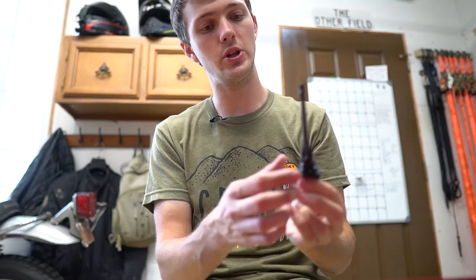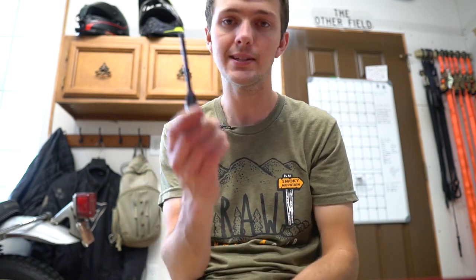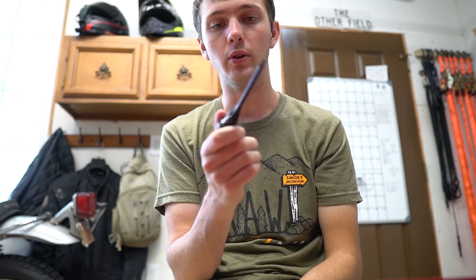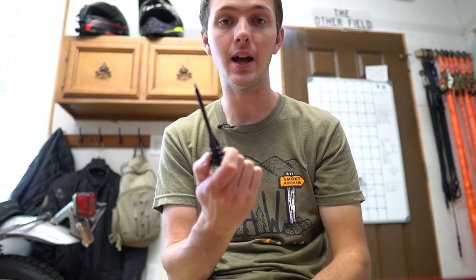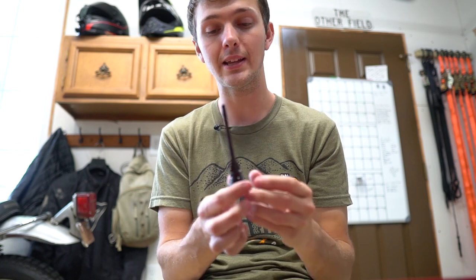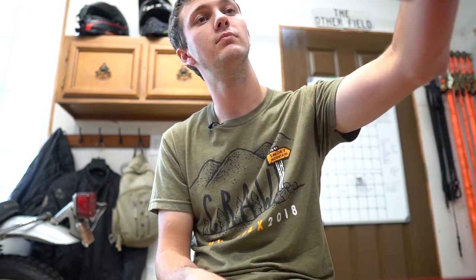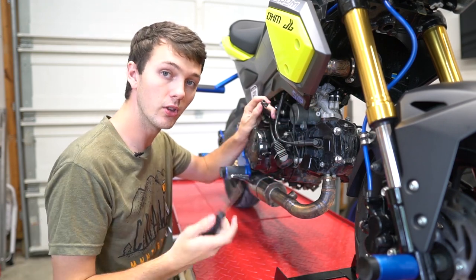So the first issue and the main issue that caused it to happen in the first place is I overfilled it with oil. This isn't the greatest representation, but it was a little past the line. So I took out a little bit of oil to try to help that. But that was the biggest issue. That's the biggest reason it happened. Obviously, oil still got in the motor, so I'm trying to help that from happening again. But the biggest thing is I overfilled it. So now the question is, how did the oil get into the motor?